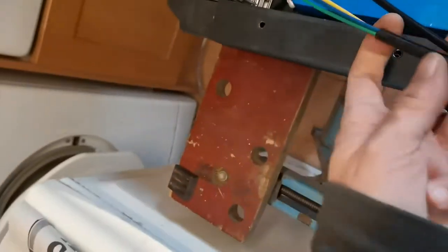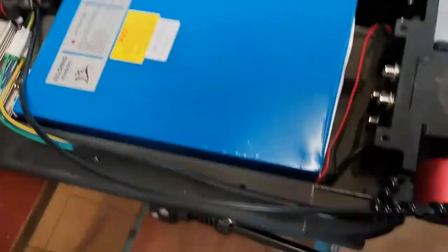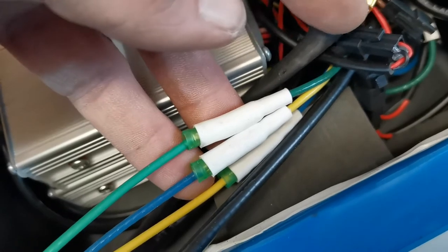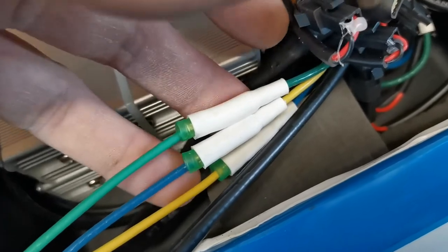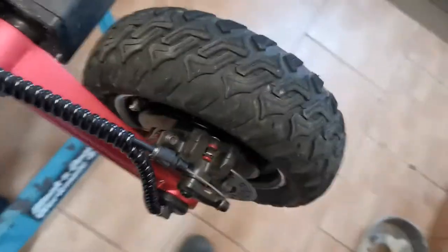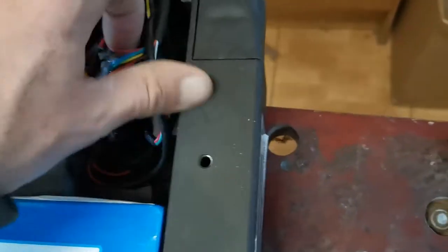Just make sure that everything looks okay — nothing's been pinched, no exposed wires. Relieve the cables for the motor and the brake cable as well because you'll need to disconnect those in a little while. Also take note: green normally goes to green, but when it's the Mac wheel, blue goes to yellow and yellow goes to blue. For the rear motor the blue and yellow are swapped. For the front motor it's mounted on the other side, which means the motor revolves in the opposite direction.